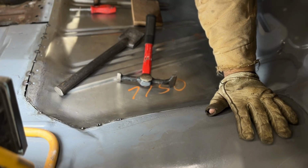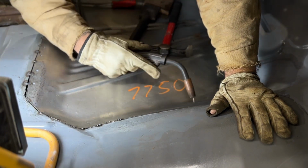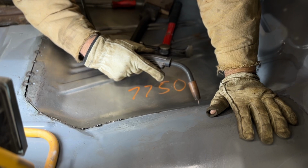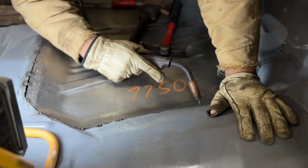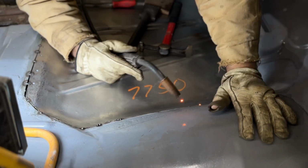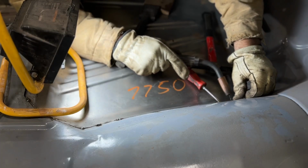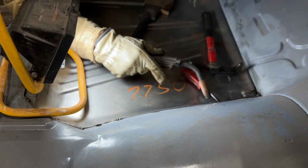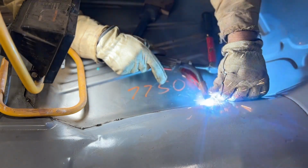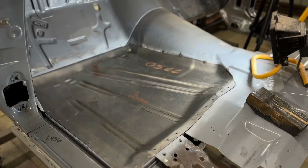This floor is a little bit thin because it is a little bit pitted everywhere. This car is a little bit pitted, kind of. I wouldn't say it's thin. It's thinner than normal in some areas. So in some of the areas where it was a little bit more pitted, it was kind of blowing through with the weld. And you can see that when you're looking at the weld and big gobs of spark are hitting the ground. Well, that's just sheet metal melting away and hitting the ground. If you look at the welds and how it's welding, whenever I show you the videos of it.